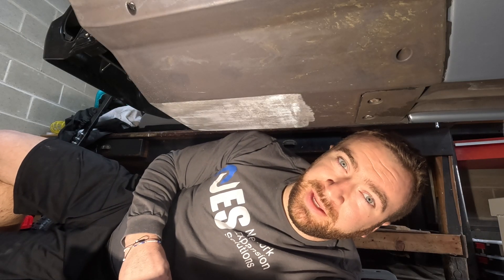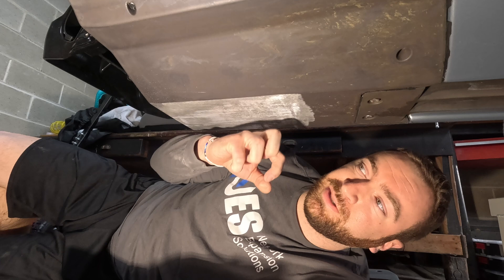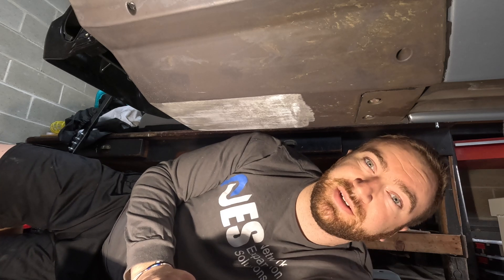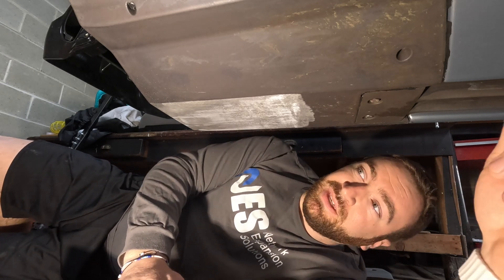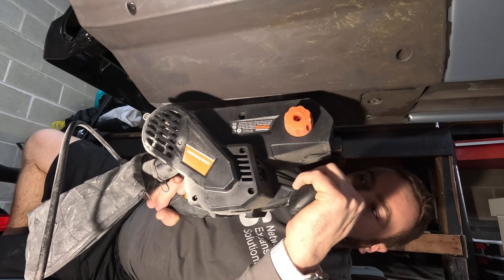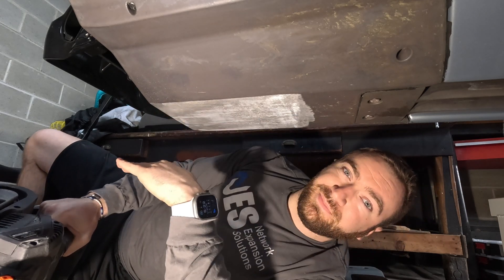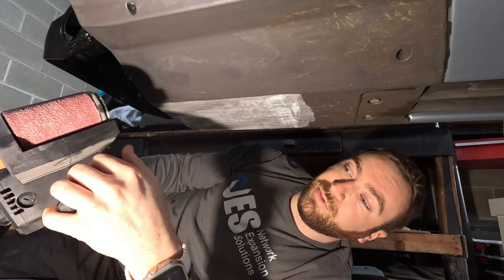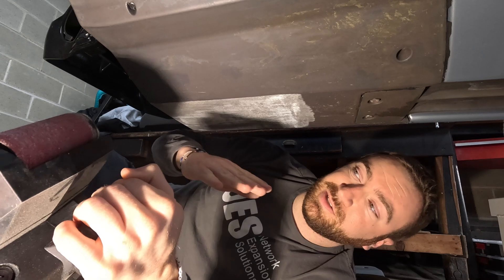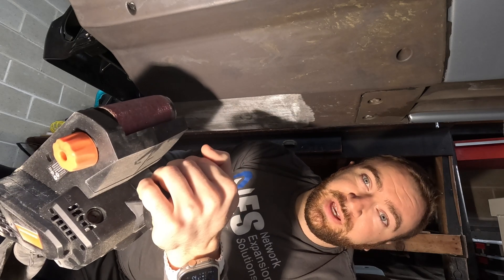Right off the bat, don't be an idiot like me — definitely wear some eye protection and ideally a mask, because there are a lot of fine metal shavings that are going to come off. I already did this so I'm just doing a couple passes and I'm not too worried about it, but you will have aluminum shavings everywhere. The technique I use: take the belt sander and work from the front back, putting a lot of emphasis on the rear of the ride plate because you want that belling-up effect. That ramp up at the very end is what's going to help the ski plane out and get more top end speed. I'll do three passes and show you what it looks like.